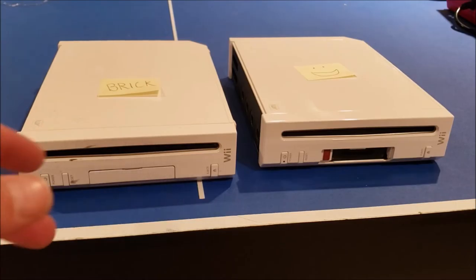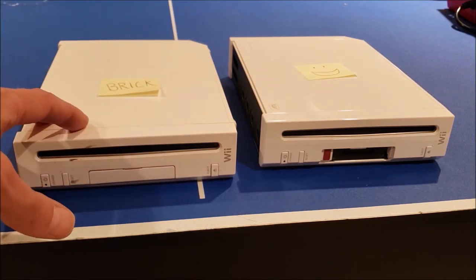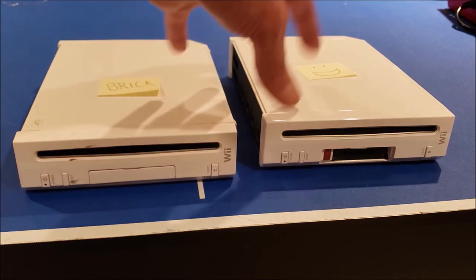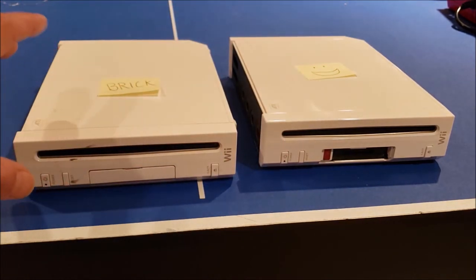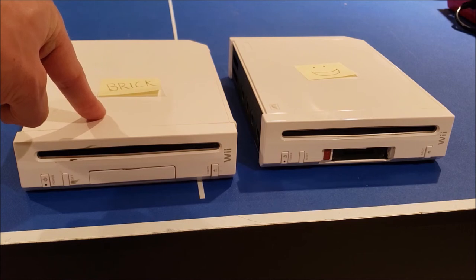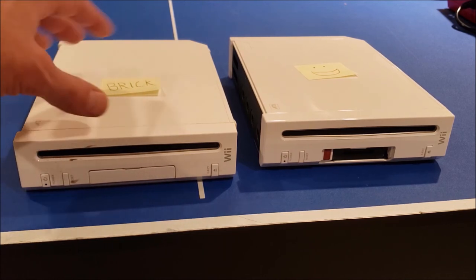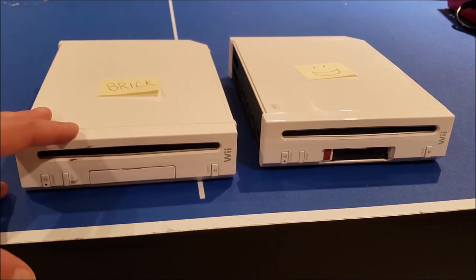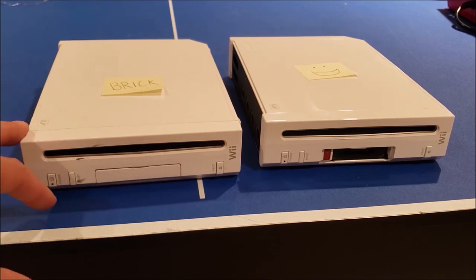I think I will do some component swapping so I have at least one good one in the best condition it can be in. At the end of the day we ended up with one out of two — that's not so bad. I'm a little disappointed we couldn't fix this one but it's the way she goes sometimes. I did take all the stuff from this one that the other was missing, such as rubber feet, the metal shield, various screws, and got it put back together nicely. My strong suspicion is that the motor driving that lens is faulty and hence it can't get where it needs to go. At that point you might as well just replace the whole drive unit itself, since I don't think you can get the individual components very easily — at least not as easily as just getting a new drive, and I don't imagine they cost that much. Well, maybe they do these days — who knows. That's it, I hope you got something out of this and enjoyed it — thanks for watching.